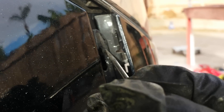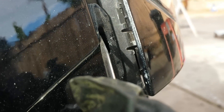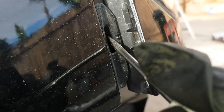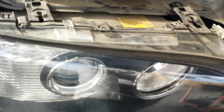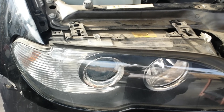You need to push this clip that way so it releases. When the clip pushes back, this slides in — and to remove it you press the clip that way so it unlatches. Once that is done, very carefully slide the headlight assembly out and you can start disconnecting all the plugs and cables in the back.